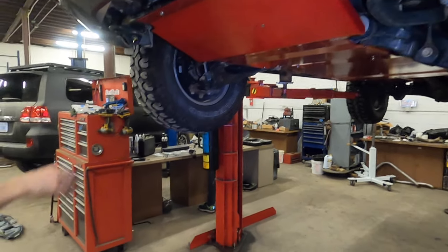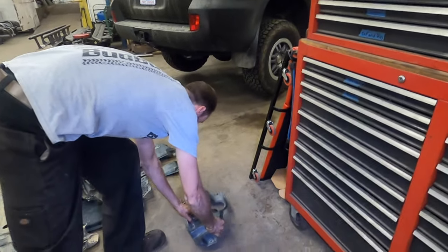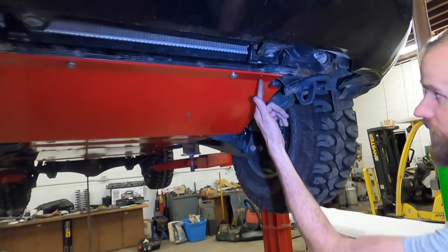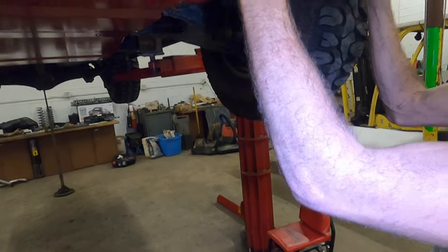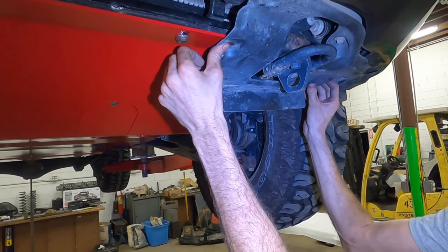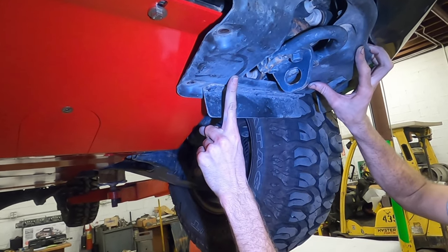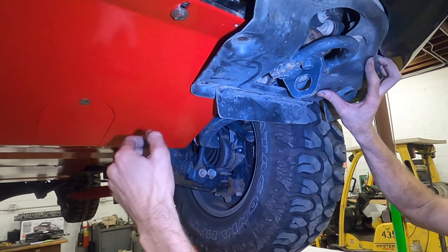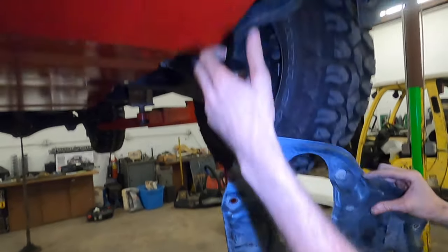So at this point, if you have a factory front bumper and you want to retain plastic valances that go over it, we have a drilled and tapped 6mm to reuse this piece right here. So I'll modify this and show you, but you can just bolt it on like that if you want. In here in the shop, I like to just cut here, down, over, and come to this one here, just because our skid offers more ground clearance than the factory one. And I just don't like things that have an attachment point that aren't attached to anything.